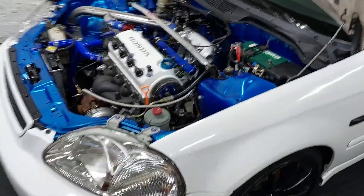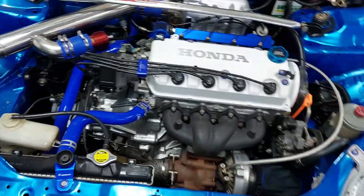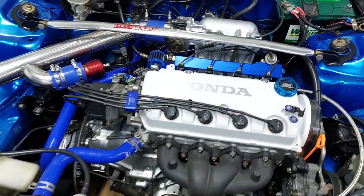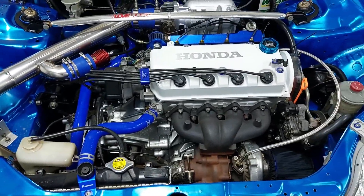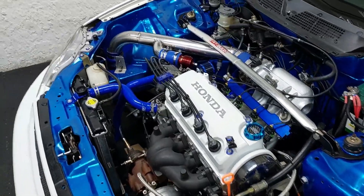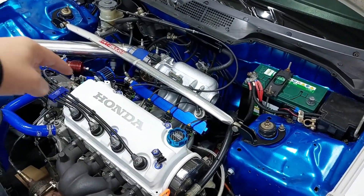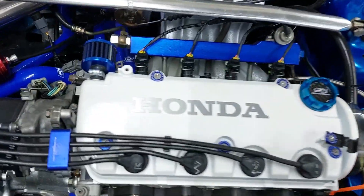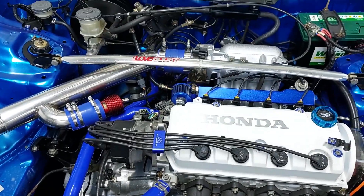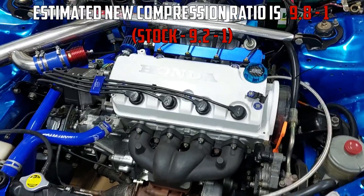Welcome to another video. This one is sadly not such good news — we managed to break the civic, even though it's not even been tuned yet. It was my fault, a mistake on my side. Basically what happened was I was testing the car after running it in with the previous tune. The tune on here should have been very accurate because the only thing we changed is the intake manifold and the cylinder head — we put a single overhead cam VTEC head on here, so there is the solenoid. The compression ratio has increased because of that, because the dome on this cylinder head is slightly smaller than the non-VTEC which it was tuned for.